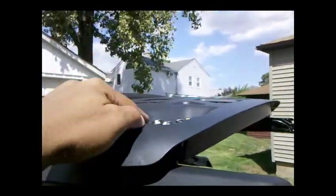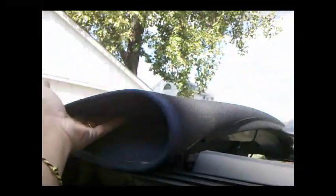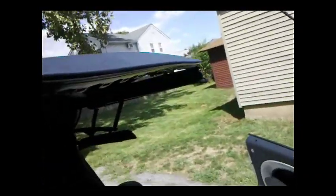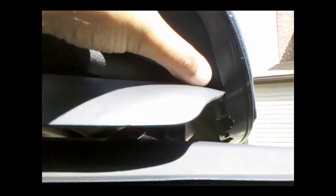With the cross brace back on and in place, screwed down properly, the next thing to do is take the canvas top, throw that forward, and give it a little bit of slack. Now these black tabs — we want to put them back into all of these slots here. Make sure that this side piece also slides under here, the edge of the metal cross beam. Then once that's done, we can take our metal cable and wire it through the latch here.